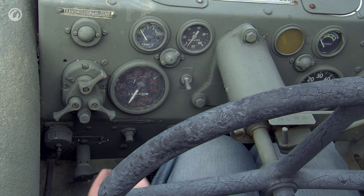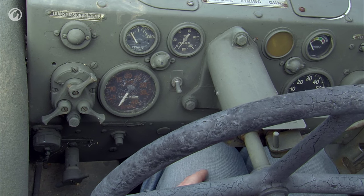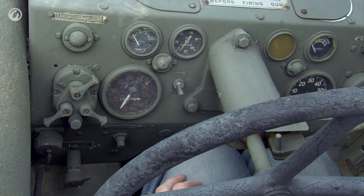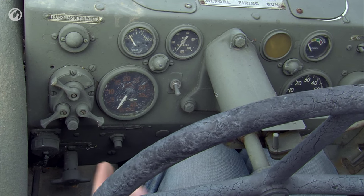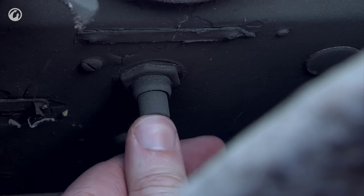So you've been driving around and you want to turn off the engine. Once you're in neutral and parked, you want to hit the fuel cutoff, which is this button here — just push down and eventually it will cut the flow of fuel to the engine and the engine will die. Turn off your magnetos, turn off your master power, and you are done. By the way, the little button up here to the top right of the master power — that's the horn. You've got to have your horn.